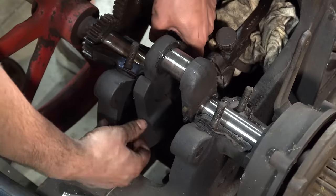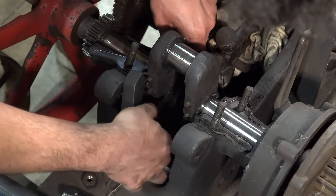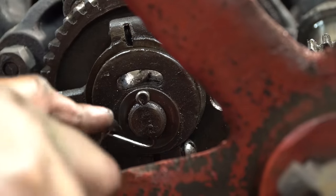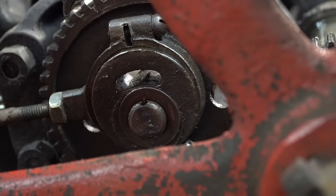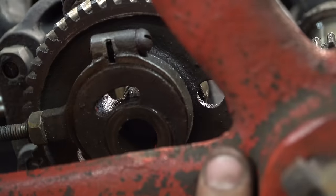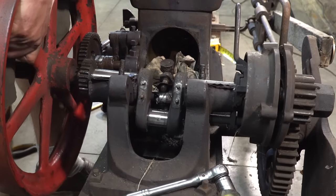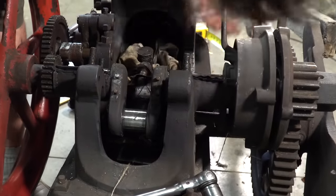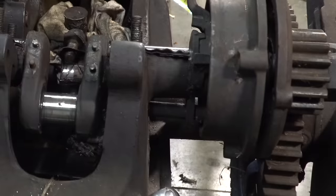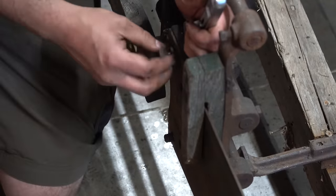The counterweights on the crankshaft are a special feature of the Ottawa engine — apparently advertised as helping the engine run smoother with less rocking and better balance. These right here are the cam gears that help with the timing of the valves and the magneto. They're very important to time with the flywheel. I've marked and stamped them just in case what's there is correct, but I won't know until I put it all back together. I then discover there's a shaft and a piece encapsulating it attached to the clutch, so I'll need to take apart everything related to the sawing mechanism to remove it.